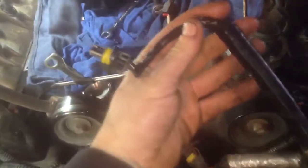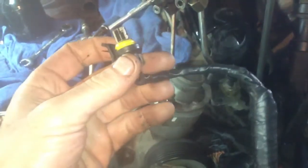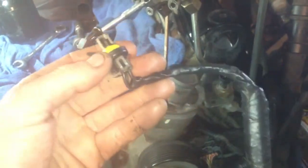That was when I first got it — low ICP. The ICP pigtail — I don't know if you can tell — I've got some oil on it from working here, but it was clean. Might as well replace it, but it looks fine to me. I don't see any obvious melting or chafing going on with it. I'm going to ohm it from the pinout on the PCM before I change that.